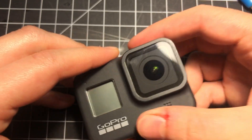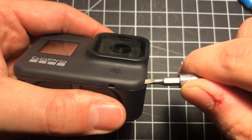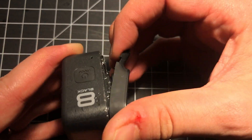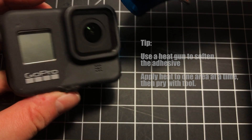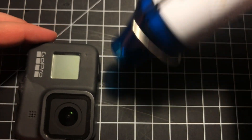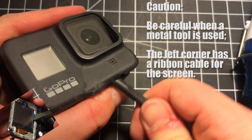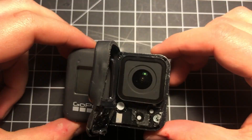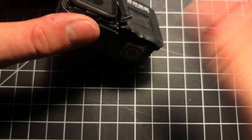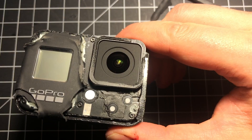Tearing down the Hero 8 Black begins with a metal tool at the lower right corner of the GoPro. You want to pry this front cover material up just enough to reveal the screws to take it off. This adhesive is terrible and there's a lot of it. I would recommend using a heat gun to soften it, then apply heat to one area at a time and hit it with a pry tool. Be careful, though — that lower left corner has a ribbon cable for the screen, so as you go deeper into the GoPro, you don't want to mess with it. Alternate between a metal and a plastic tool, hit it with heat, and keep going until you reveal the six main screws around the base.